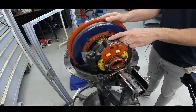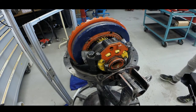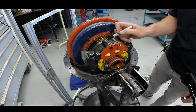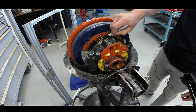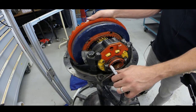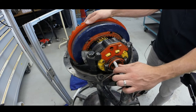It doesn't really look like it, so what I'll do is grab a marker and make a mark on that pinion, and I'll rotate the bevel gear all the way around. I'm going to mark the high speed plate so I know where I'll come back to, and I'm going to mark one of those pinion gear teeth. In low, I'm going to rotate the bevel gear through one complete revolution and we're going to see that that pinion rotates — it doesn't come back in the same spot. That's because we're in low.